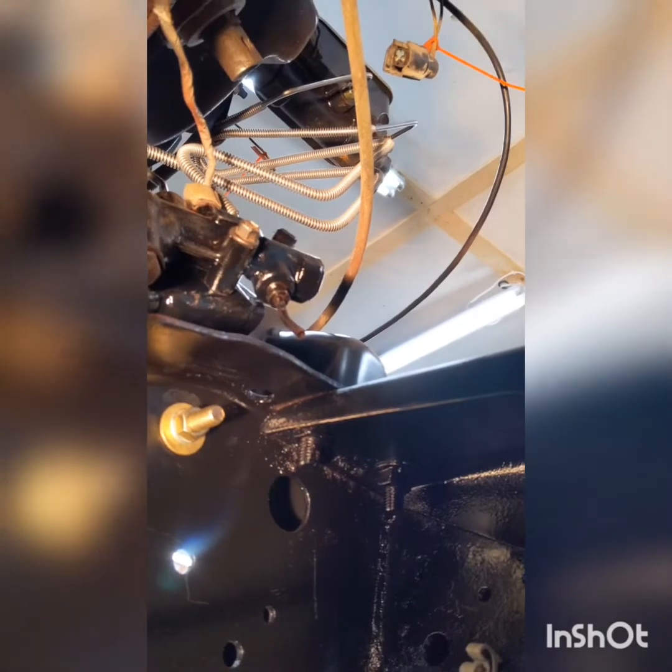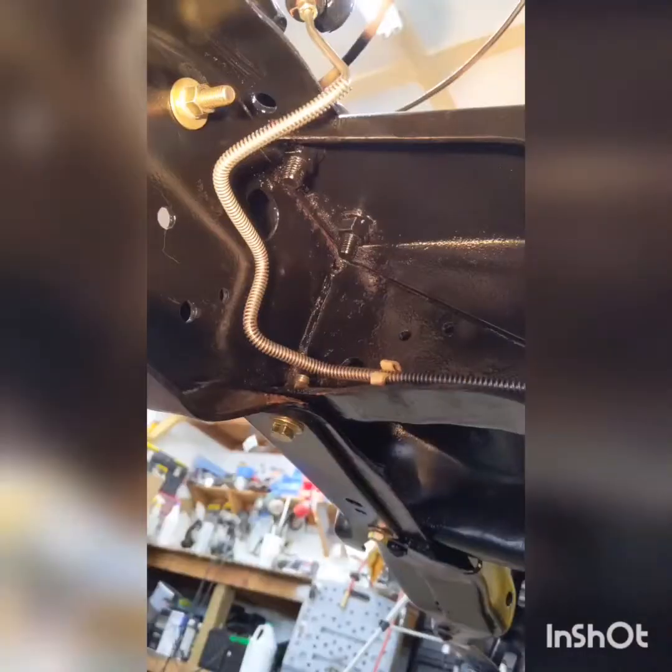Okay, so the old brake line that's on there, the fitting on the proportioning valve is a 7/16, and the one on the new line is a 3/8. So when you go to do this, you'll definitely want to take both wrenches down.